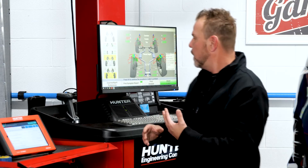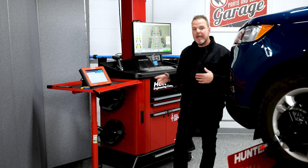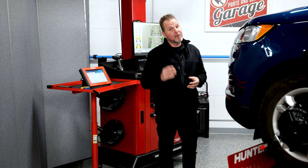You can also choose a pre and post scan on the beginning of your actual home screen. If you choose a pre scan and a post scan, it'll walk you through a comprehensive repair procedure: you're going to do your pre-scan, you're going to do your blueprinting, then it'll walk you through your alignment, then it will walk you through the procedures you need to do for your calibration. Once you're all done with that, you can do your post-scan, test drive it, and print a complete report on everything that was done before, during, and after. This is how Hunter is making sure that ADAS calibrations are done correctly for you and your shop. Thanks for watching — we'll see you next time.